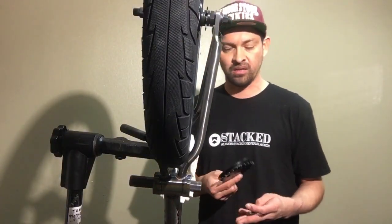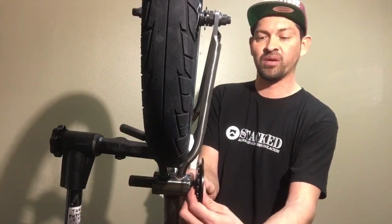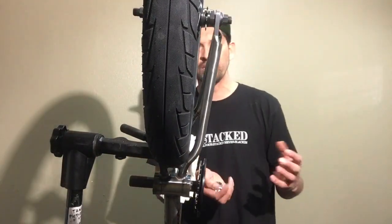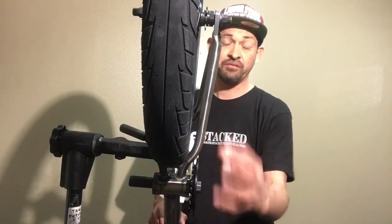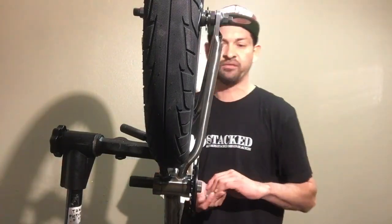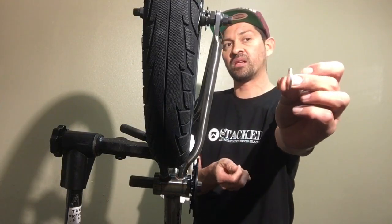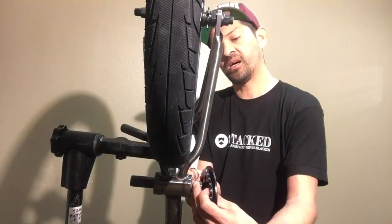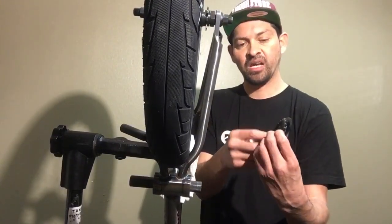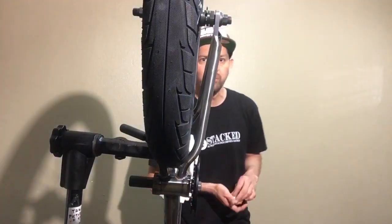Start with the hat washer, because you definitely need that to fit onto the spindle. I'm going to put it on first with no spacers — notice the teeth are really close to the chainstay, so that's way too far in. They include different spacers to move it in or out. For this setup we're probably just going to need the 2.5mm spacer. Make sure you grease anywhere metal touches metal.